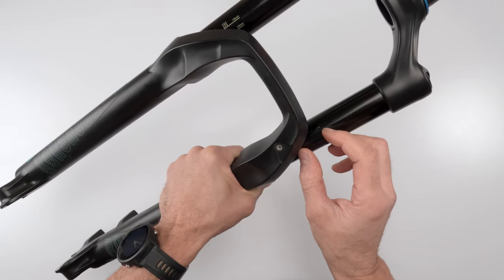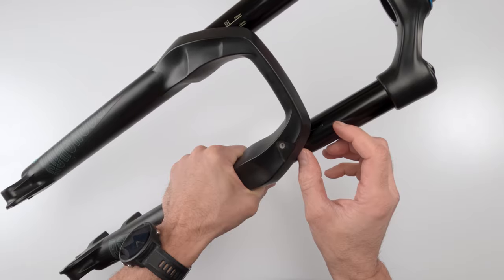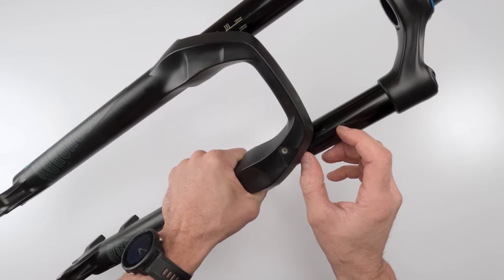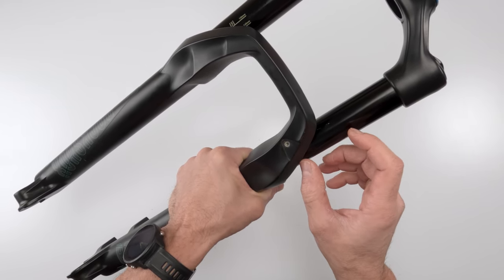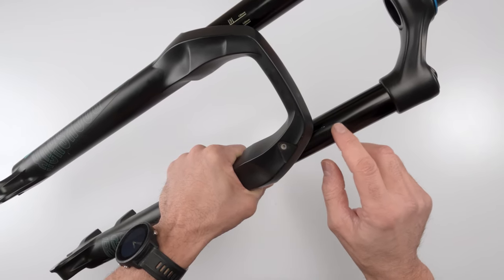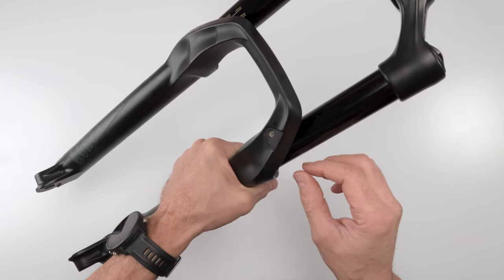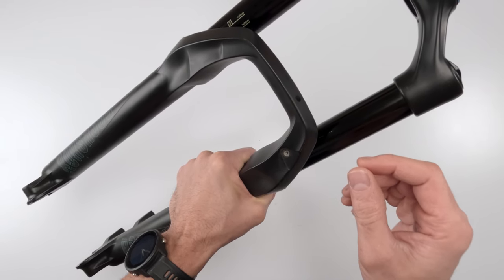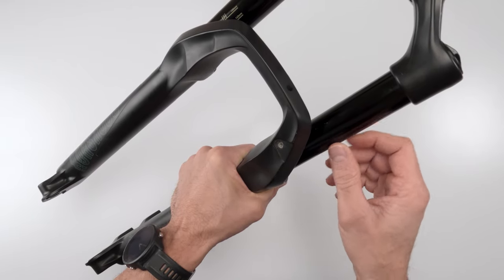Technically, you can fix something like this, but when it's in the middle of the stanchion, I don't know, man, that's a tough one. If it's deep enough, like this one, groove and long, vertical especially, think about it, you're constantly in this area of travel when you're riding, right? And if you don't fix it perfectly or real well, get a real smooth, round finish, well, you're constantly going to be seeping oil out of your wipers, right? There is going to be a gap, a space in the wiper and the stanchion. You might not be able to see it, but it will be there, right?